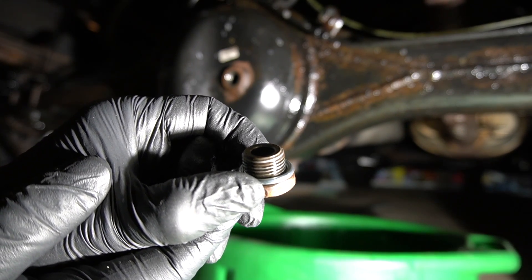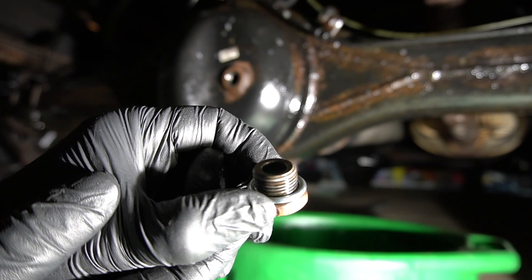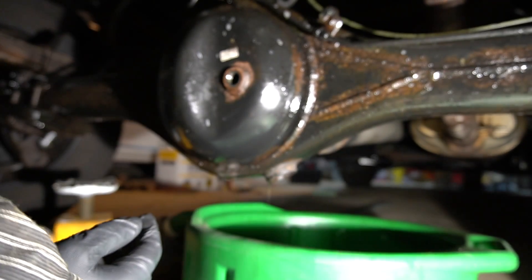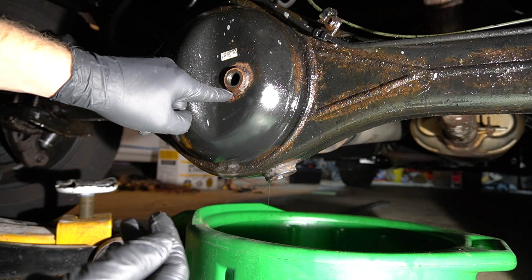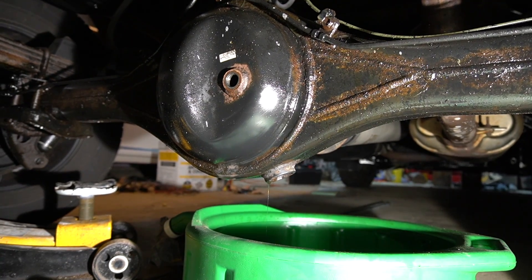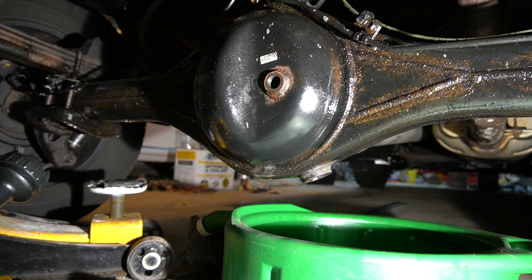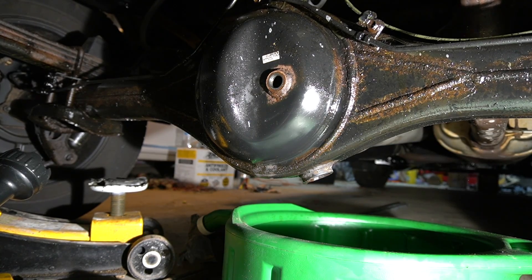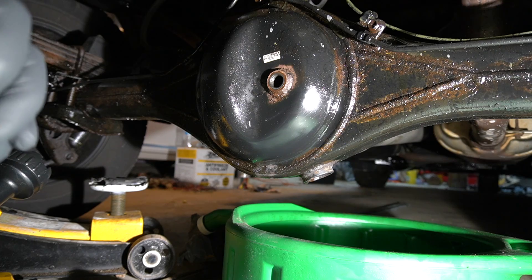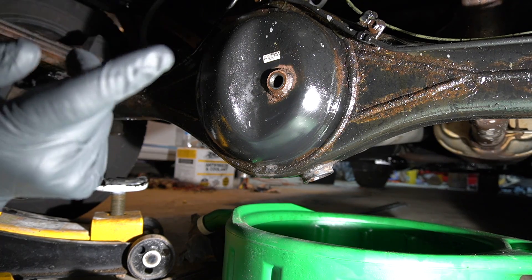According to the specs, the truck, car, or SUV should be on a level surface. You add fluid to the point where it starts coming out, or 5 millimeters below. I just verified on Toyota's website for this Tundra 4.6 engine — it actually takes 4.9 quarts of gear oil. The 3.2 to 4.2 quart range is for the 5.7 engine. The V6 and 4.6 have larger capacity.